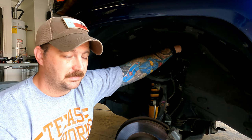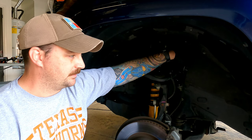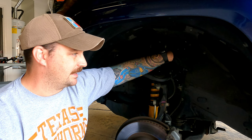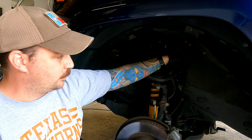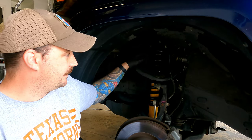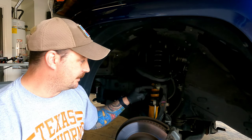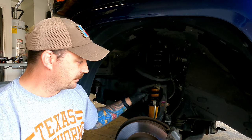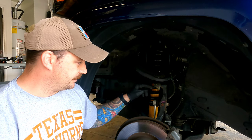Be very careful removing the shielding because it's flimsy plastic and can break — so be careful if you want to reuse it. Once those are out, we can gain more access to the bolt and nut inside here so we can loosen them up and pull the bolt out. We'll also be removing the cotter pin and castle nut at the bottom of the ball joint where the spindle connects. After loosening the castle nut, we'll hit the side of the spindle with a hammer to break it loose.